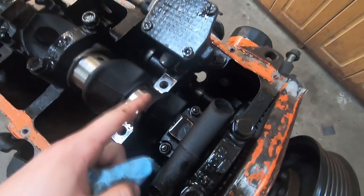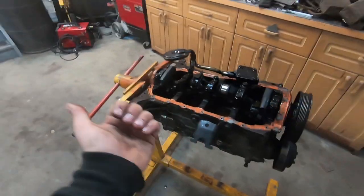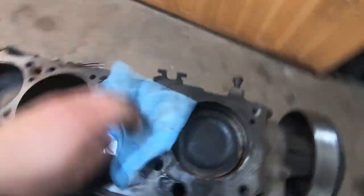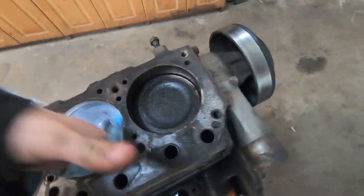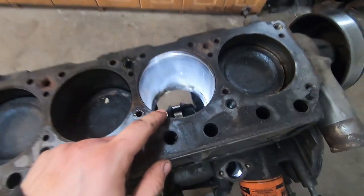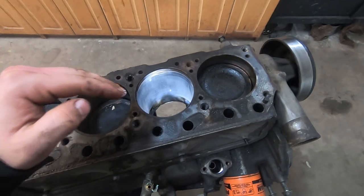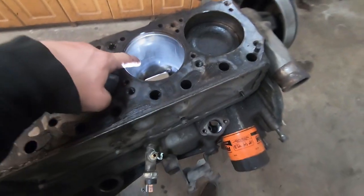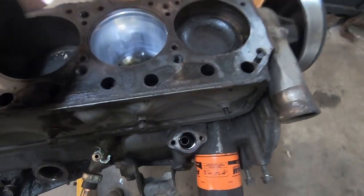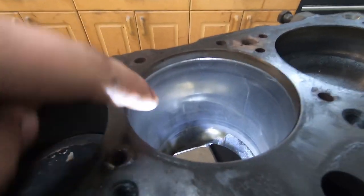250,000 kilometers — I'm gonna call that pretty damn good. I'm gonna flip it around, check that cylinder, and then I'm gonna show you the 3 liter very quickly. That's just like mirror polish in there. What you want is a crosshatch — basically like strategic grooves in your cylinder that help control oil. A smooth wall like this will let oil flow by the rings easier than one with a crosshatch pattern, so that's where some of the power was going. It's super worn and that groove is huge.